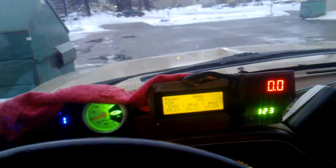The big spring in the middle is the governor spring. If you replace that with a stiffer spring, or add a spacer or two to stiffen it up, you'll increase the governed RPM. But if the length is the same, you aren't going to affect anything else — you'll just affect the governed RPM. With the spring I've got there it's governing at about 3,600, which to me is just fine. I might try making it 4,000 later.